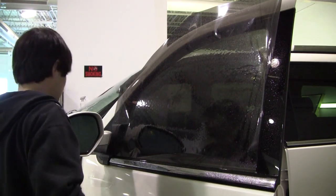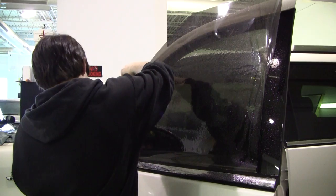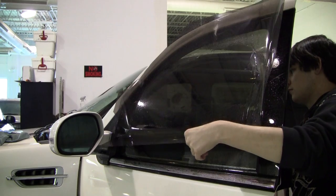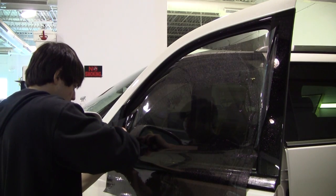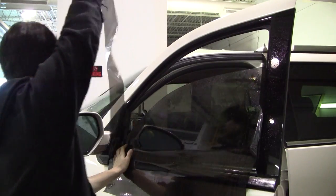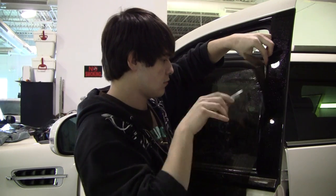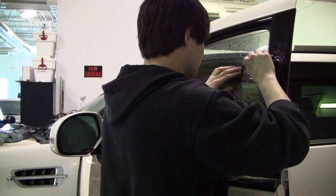Shift it over about a quarter of an inch. Cut from the top to the bottom on the left side all the way, because the window does not shift out of the seal on that side. Shift it back over an eighth of an inch and squeegee it to the window. Pick up the bottom edge and roll it down just a little bit farther than the Denali, because that top edge stays inside the seal a bit longer. Cut out the top edge — it's got a bit more of a point in that corner, so I have to make another cut on that side. Take the blade and go as far down as you can in the seal without cutting the seal. Peel off the excess film, then roll the window up so I have a little more surface to work on, and round the corners.